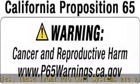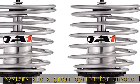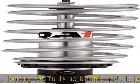Choose a spring rate and adjustability that fits your driving style, adjust the valving to match and you are on your way. These shocks also utilize a fully threaded body that allows you to adjust your ride height for the perfect stance or to finely tune the weight balance for superior handling.